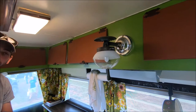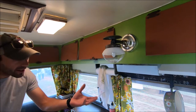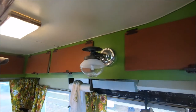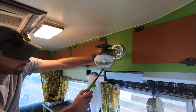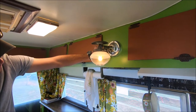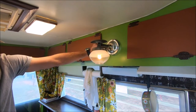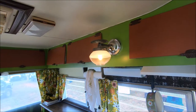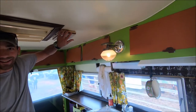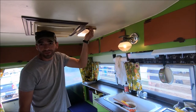This is original to the camper — a propane lamp. Works just like a Coleman camp lamp; it has a silk mantle inside. We can fire it up here: just turn the gas on, let the silk mantle heat up, then adjust the gas for brightness. So you're never without light. It puts off some heat too, so in wintertime we'll sometimes fire up the lamp just for a little extra heat.